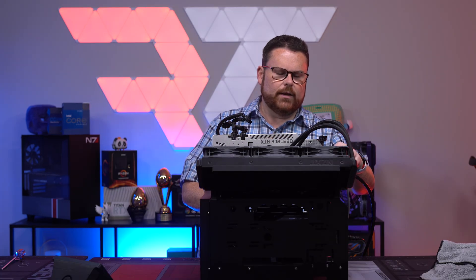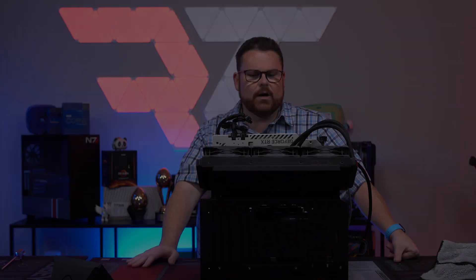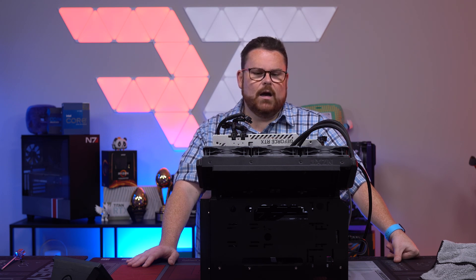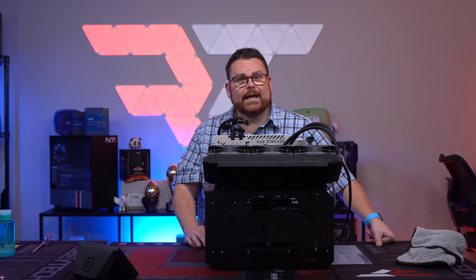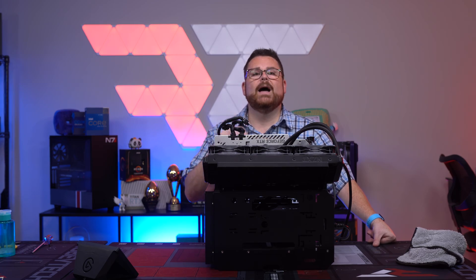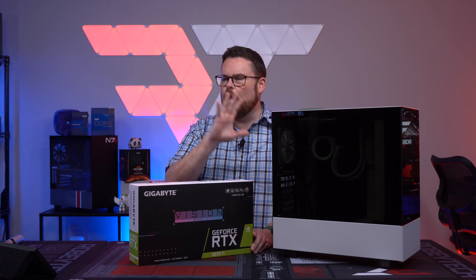One more time we're going to try the other plug — right to that VGA. Something is definitely damaged or broken about this particular GPU. We are going to go ahead and RMA his graphics card because everything else looks like it works absolutely fine. So it's literally just a dead graphics card. With the magic of YouTube, we now have an RMA'd RTX 3070 Ti. We are going to pop that in because we believe that is the problem — all the troubleshooting points there.